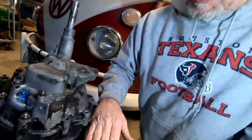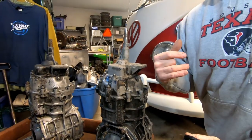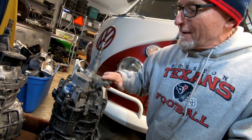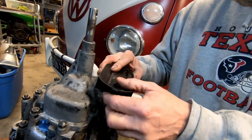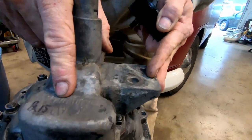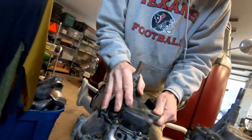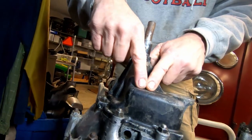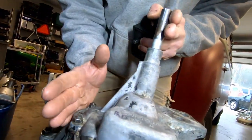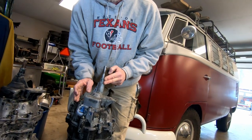Let's look at something real quick too. A bus transaxle — at least a split — and swing axles, the transmissions are the same, only they just flip the ring gears. In a bus, if you put a beetle transmission, you have four reverses and one first. But the other main difference is what we call the nose cones — this is what the transmission mount hooks to at the front. You can see a bit of the difference here on a bus from an angle standpoint. You can always check by looking at your part number: if it starts with a two, that's a type two, that's a bus part. Look at the offset on a beetle nose cone — this one starts with a one, type one. You can see the angle is more to the top of the transaxle. Over here on a bus, look how it's a little bit lower — this is because the bus is running reduction boxes to get everything in line. Don't try putting a beetle nose cone on a bus. You'll have some issues.